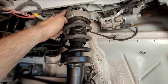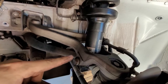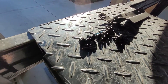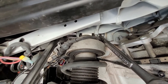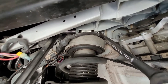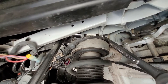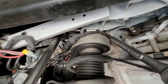I'm going to disconnect this connector and pull the bottom bolt out right here. One last thing — all those Torx screws are T30. You could pull all the plastic out of the frunk, but I've opted not to do that. You can access this from underneath here and do just a couple clicks at a time to get this off. It might take a couple extra minutes versus 20 minutes to pull all that plastic out of the hood.